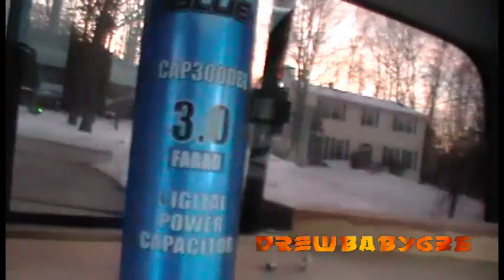Right now I don't have an amp in here, but I'm going to put the amp down here once I get it back. And it's my 4-gauge for it. And you should have a fuse also going from your battery to your amp on the positive leg too.